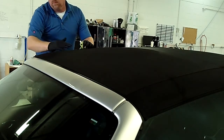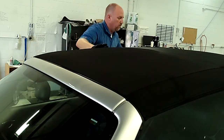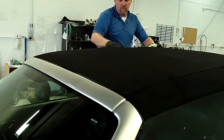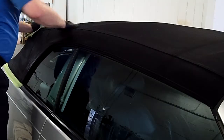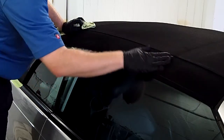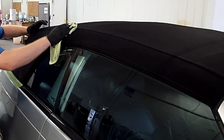So if you've got an older car and you don't want to spend the money to have the thing completely redone, and it's still watertight with no major issues, this is a great way to just bring it back up and get a few more years out of it. Up here in Ontario we've got a lot of issues — if you're running it all four seasons, there's a salt brine they put on the road that affects canvas and will bleach it down. If you're living outdoors, running around town, you're going to get bird droppings and that type of thing. Re-sealing it every couple of years is a pretty good idea.